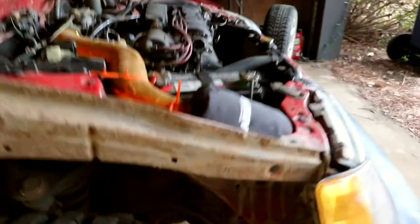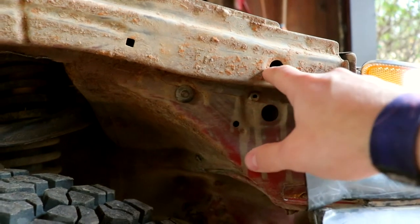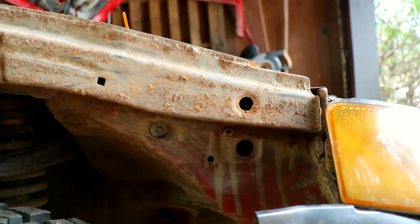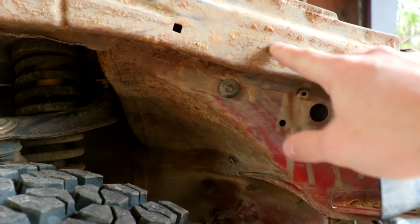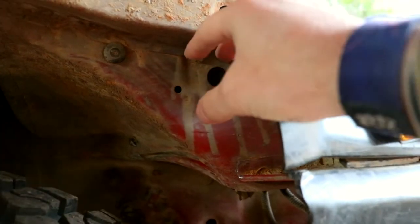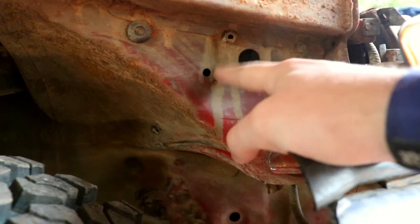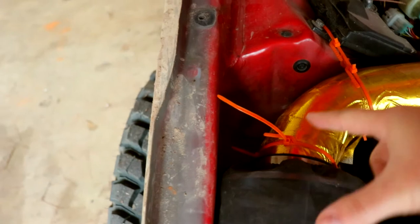I've got the fender off here — I took it off in last week's video. Looking at it, optimally through the fender I'd be able to cut it here, but this frame rail kind of runs along there. So I think the best option is to cut my three-and-a-half-inch hole saw right here, open it up, and run some kind of pipe to connect the snorkel. I'm going to go ahead and cut this so I can get the fender on and figure out where I need to cut it, because I may have to trim it back to run to the snorkel.